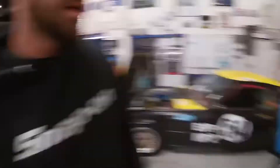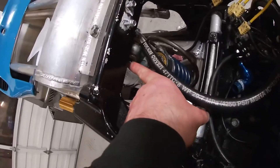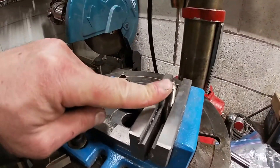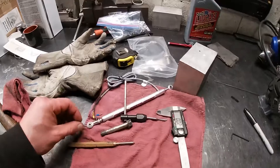Next, I figured I'm gonna start making the shock sensor. Here's what I came up with. The shock sensor needs to be basically bolted to the top bolt of the shock and the bottom bolt of the shock, which is right down here. I found two other bolts from my toolbox and I figured why don't I just drill and thread that bolt with M4 by 0.7 bolts — these guys should fit no problem inside the shock. I'm gonna do a time-lapse video to show you guys what I've been doing and how I'm doing it.